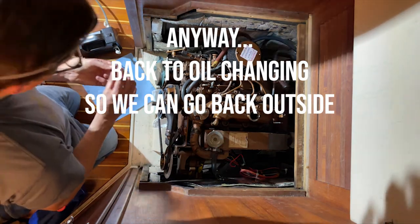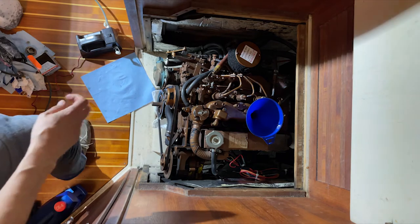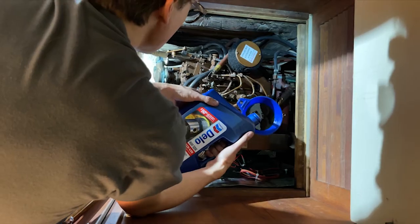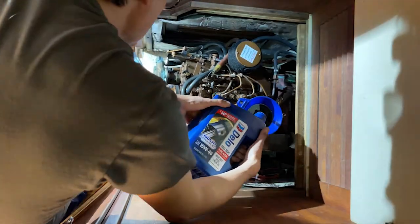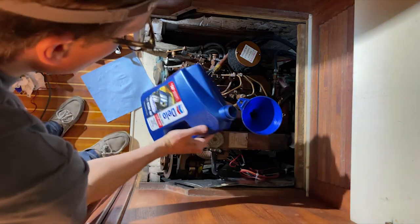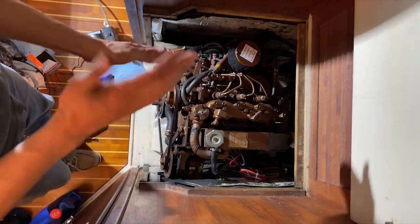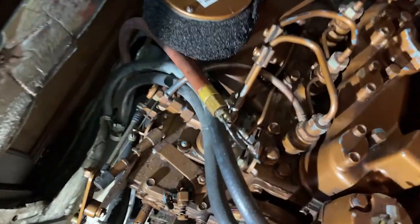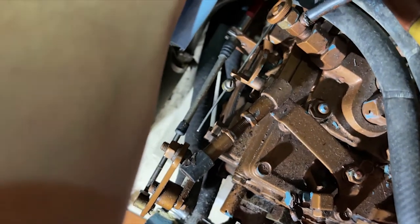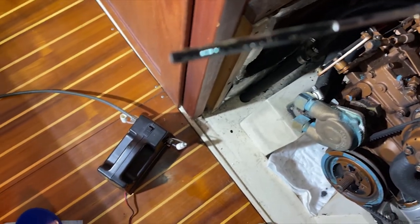Now let's put this cap back on — just clip it on there so it doesn't go flying all over the place. Now we add four quarts of fresh oil. We removed a full gallon of oil, so that is what I'm putting back in. But we will check it before we go on any long adventures. Now that we've filled it up, we're going to check the level. The dipstick is way over here — super annoying and hard to reach. We'll wipe it off and stick it back in. It might be a little over full, so let's run the engine now and check it again.